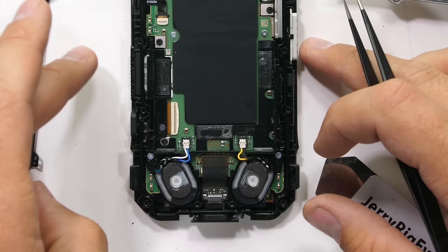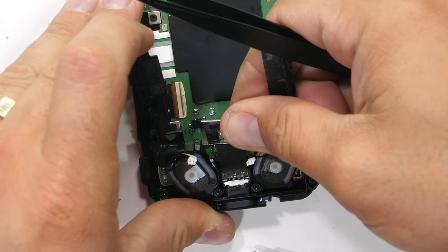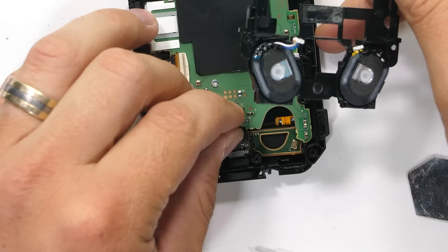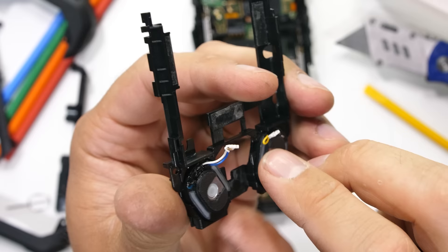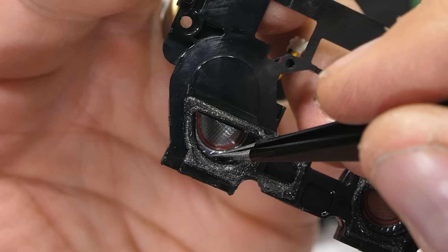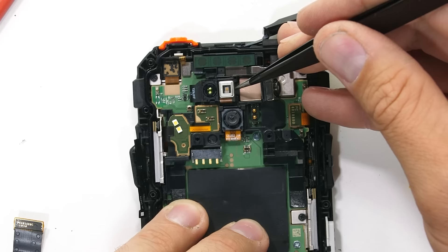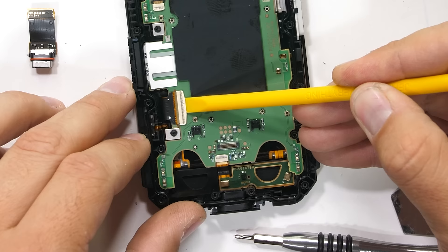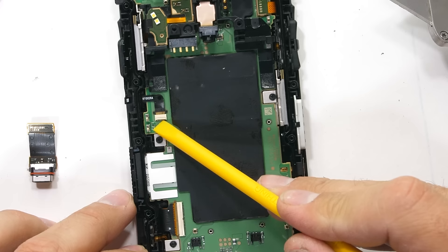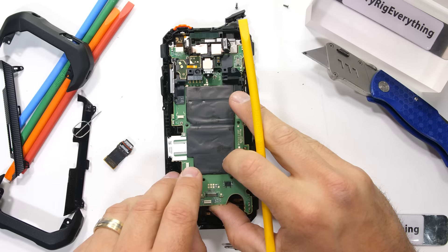We have two more screws holding down two massive speakers on the bottom of the phone. I'll unplug each of their connections and lift them out with the USB-C charger. These speakers are huge and they aren't even in boxes. Then we have the charging port with its own red rubber ring, which further assists the ingress protection. Everything, including the rear cameras, still seems to be permanently attached to the motherboard. So I'll pull out another five screws, bringing our total up to 38, then unplug some latch-style connectors and remove the expandable memory and SIM card tray so we can pull the whole motherboard up and out of the phone.